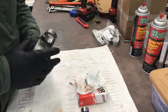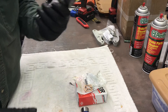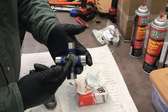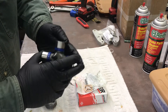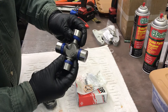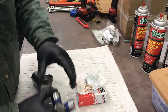Once you've got the yoke assembled with the u-joint in it, it's easy to lay it up against the drive shaft and repeat the same procedure. It's a little more clumsy than just having this, but same procedure. I hold the cross of the u-joint right up into the cap — this relationship does not change. I just push it in and out and the whole thing stays together. When you try to come in from both sides with a gap, that's when you drop your needles. You've got to keep the whole thing in its correct position and just maneuver it in and out of the yokes.